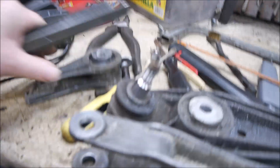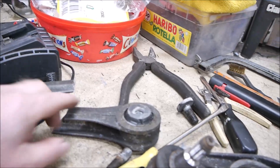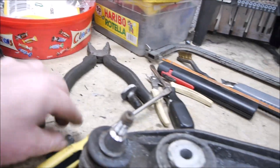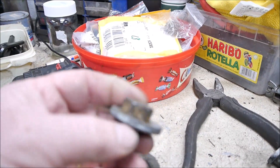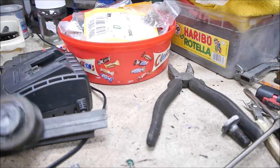So that's the rear suspension on that corner. This was all to do with the eccentric bolts that adjust your toe and camber - I could not adjust them because they were completely solid. Let me show you what we ended up having to cut off. I had to cut the rear toe bar off - the rear track control arm - and you can see this pin here; this is the eccentric bolt which was completely seized in there, so I couldn't adjust the toe. That's scrap.